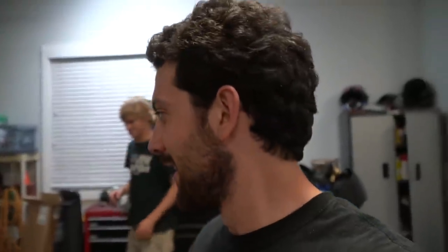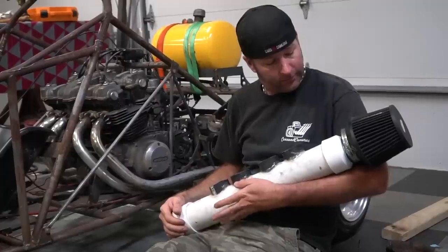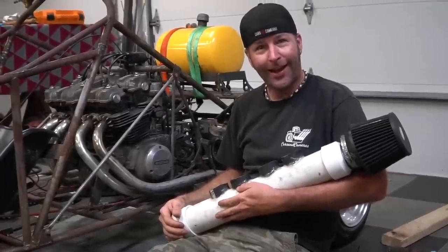All right, so we're out of time today. Ike is playing with his power tube. The carburetors are decently synced. We're at a point where we need to take them off and jet the emulsion tube or the jet a little bit more, or open up the emulsion tube and open up the jet a little bit more. But we're out of time today, so we're going to be tackling that next time. But I think it's performing a lot better than it was last time just with our power tube intake. So we're hoping just a few more rounds of jetting and this engine will be running perfectly.